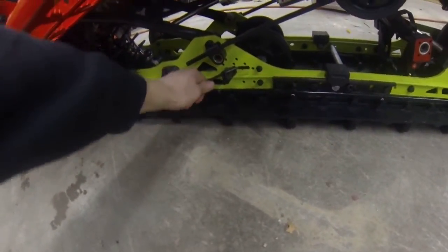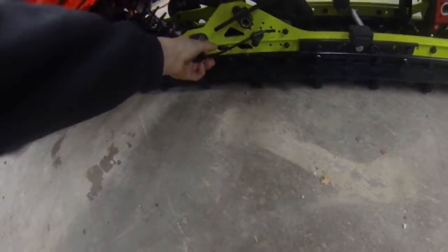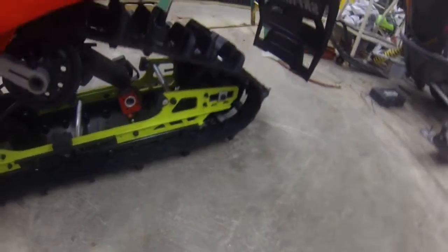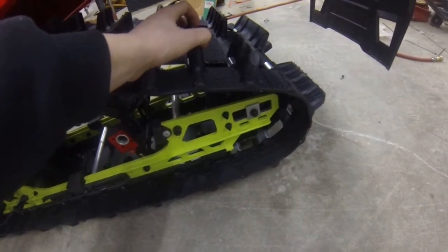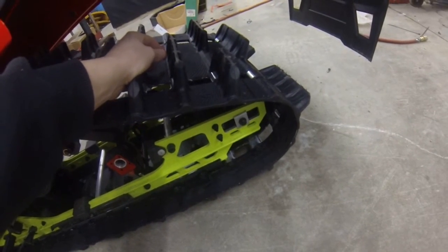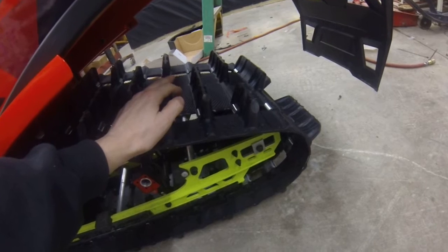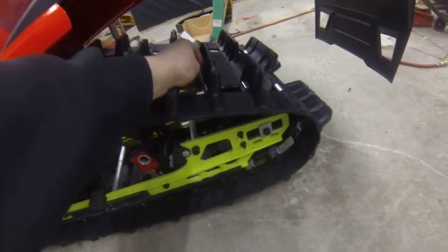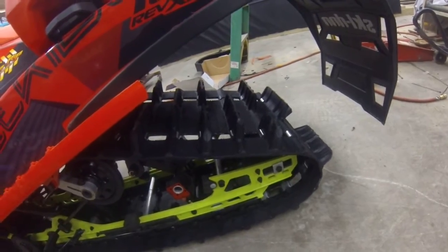So Skidoo Reversibles — took out the rear farthest rear wheel. Thanks Jeff McGurr, I just followed his video, shout out to him, check his channel out, I'll have it in the description. So I went from an inch and three-quarter paddle, the Powder Max which are 16 inches wide, to a Backcountry X2 which is a two-inch paddle and they're 15 inches wide. I just wanted a two-inch — didn't want 2.25, that's a little bit more than I need here. And I just didn't like the paddles on the Powder Max. I've always had awesome luck with these Backcountry tracks on every sled I've ever owned, so I'm gonna have a good time. And I installed the ice scratchers at the same time.